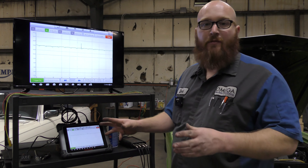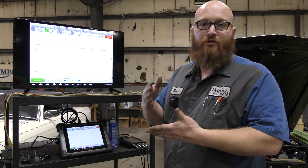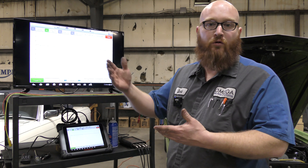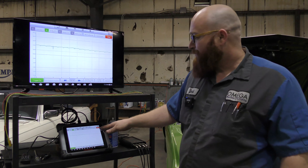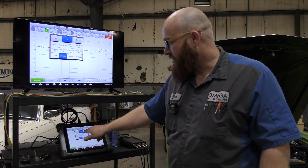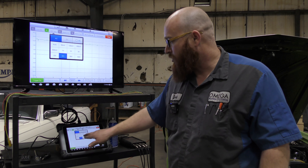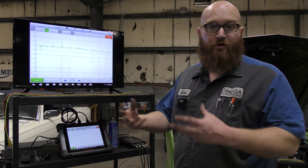You can set this machine up to look at different sensors — all kinds of different sensors. But you need to know: is it a 5-volt sensor, a 12-volt sensor, a 1-volt sensor? Like an oxygen sensor would be 0 to 1 volts and it would kind of be a sine wave. You can change the time frame on it, change all the different voltages you would use — you can do AC volt, DC volt. You just set it up based on what you're looking at.